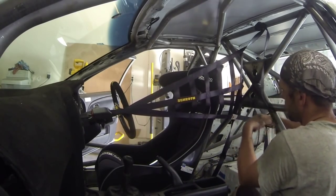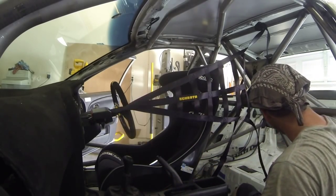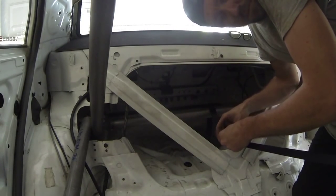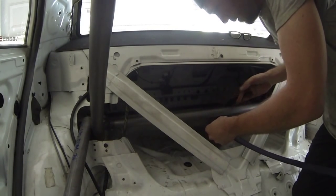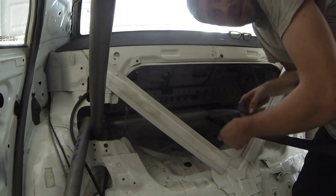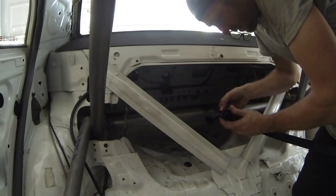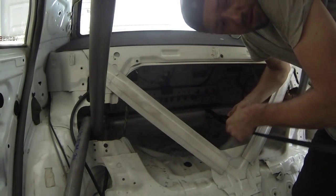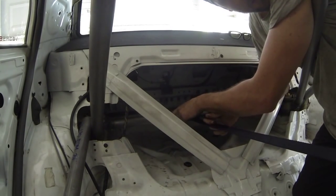Over here there's absolutely nothing for us to tie onto, and there's quite a lot of excess on this strap, so I'm actually going to tie into the rear strut bar that we fabricated earlier. We're just going to loop this around and make sure that the straps don't twist — that's not allowed. I'm going to send this loop through, back up through the buckle, and cinch that down pretty tight. I want it nice and tight, pulled a little bit closer toward the driver.